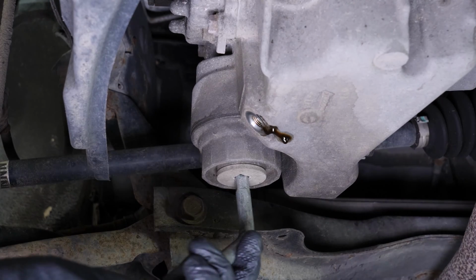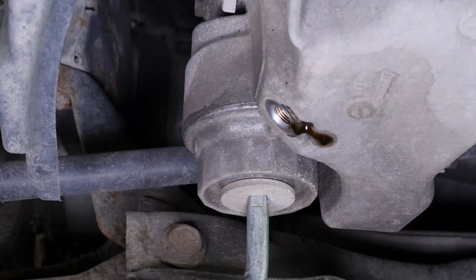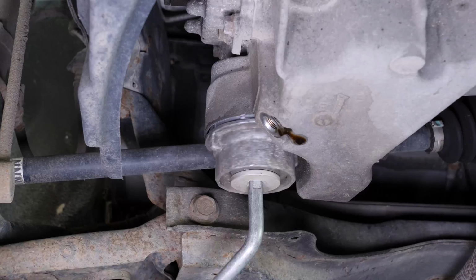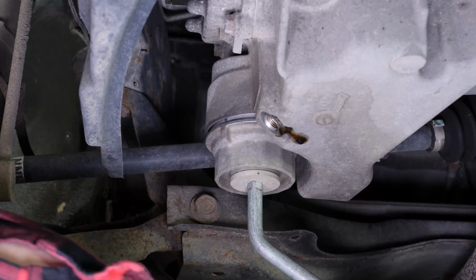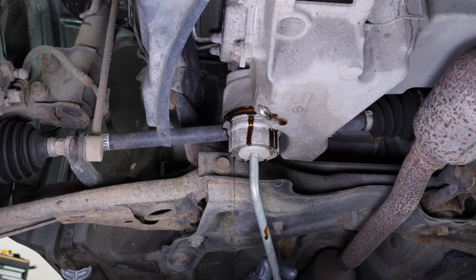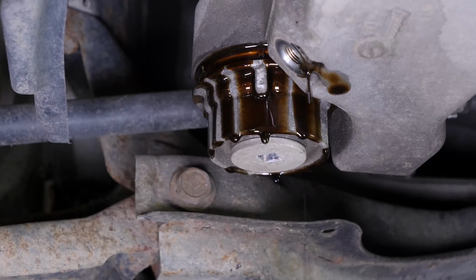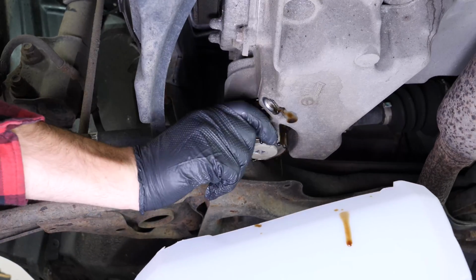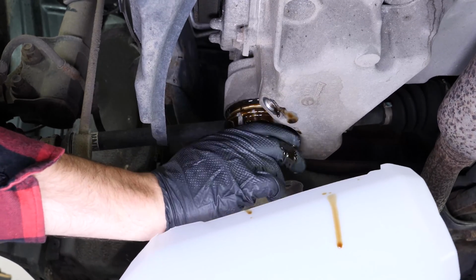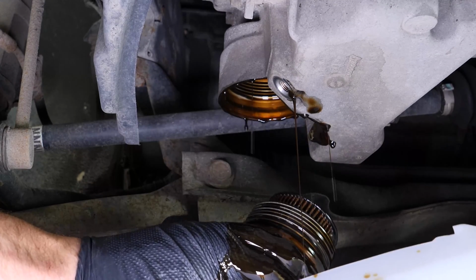When performing an oil change, it is necessary to replace the oil filter. Access to the oil filter is done from underneath the engine compartment. Using a chain wrench, release the oil filter flange by turning it counterclockwise until it turns easily. Finish unscrewing the cup by hand. When released, turn it upwards to avoid spilling any oil.